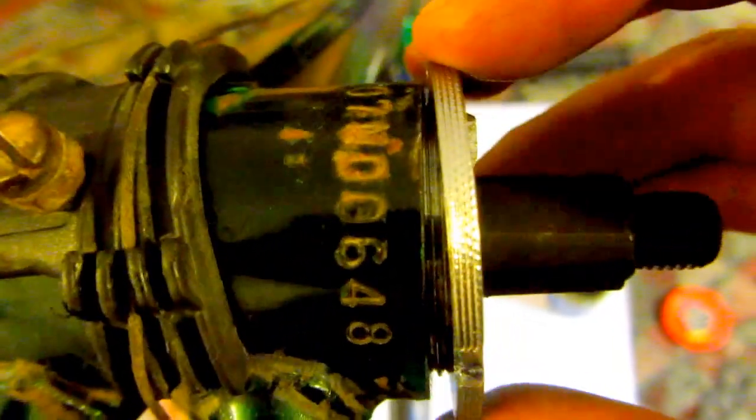Okay, and I will screw this one in counterclockwise and then adjust this movement from this side. Okay, so this ring was changed for a smaller one. The original one I inserted first was 2.5 millimeters thick, and this is only 1.5 millimeter thick, and that leaves a little bit more space here so that I can screw this ring on. It has some threads there. Okay, and this one is still rotating well.